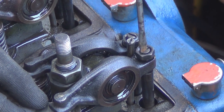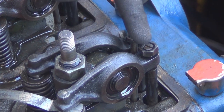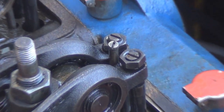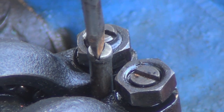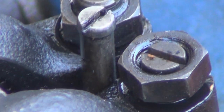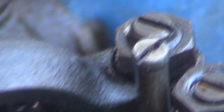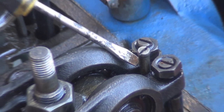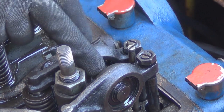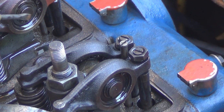What's the adjuster in between the two rockers? That is the oil feed. So when the engine's running - it's not an adjuster, it looks like it is from here. Yeah, you can basically undo that and blow out the oil feed for the rockers. It works on the pressure on the crank casing - it's a feed off the camshaft. That feeds oil up and it pulses, so it's just little jets onto there and it'll run into the bearings.